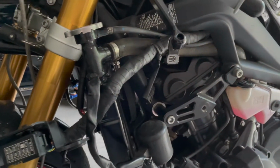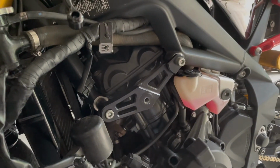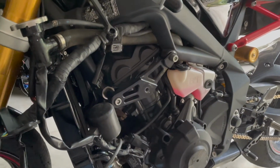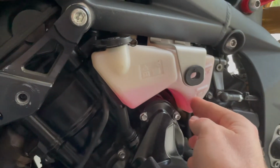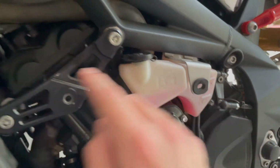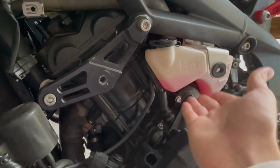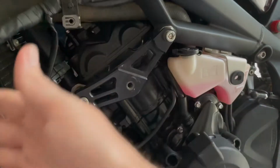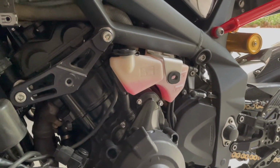At this point, I think we're done for tonight. Again, the cooling fan cycled on and off, I think 3 times, and I revved the engine up a bunch too, so that should have circulated everything through the cooling system well enough to get most of the bubbles out. If there are any little bubbles left, they'll just kind of work themselves out naturally. But the overflow tank, I actually overfilled it a little bit, and then I noticed the level dropped, so that's good. That means we got some air out of the system that was still trapped in there. As the bike cools off, it will draw coolant in from the overflow tank to replace the air that is going out since the system is under pressure, and we should be good to go. I'll check the overflow tank again after the bike's cooled off.